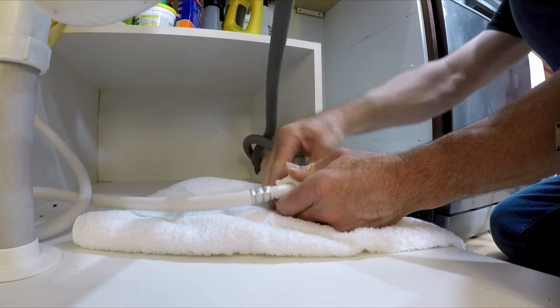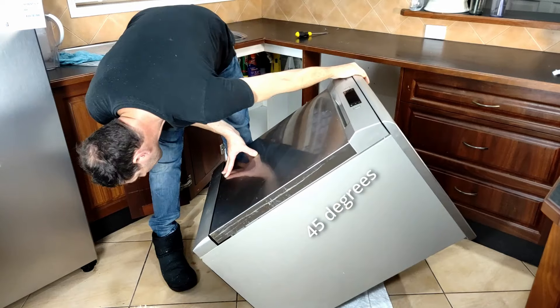Number four: the next thing to do is to empty the drip tray, which is like an overflow mechanism or a safety circuit with the dishwasher. We're going to need to pull the dishwasher out from here — tilting it over will drain the water from the anti-flood collection tray at the bottom of the dishwasher. Once you've drained the water, the float switch no longer detects water and it'll work again.